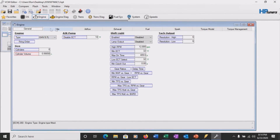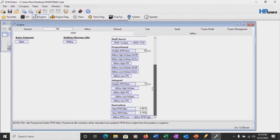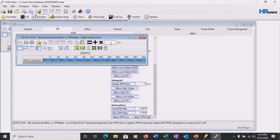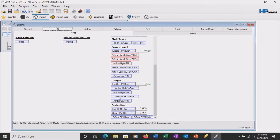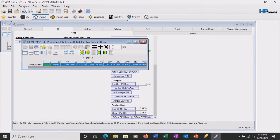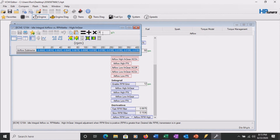We're going over to the idle tab, clicking on the RPM tab under idle. We can see the adaptive idle numbers and we go down to find anything referencing grams per second - the proportional, integral, and derivative, all in grams per second. We open the airflow high and low and multiply all by 0.8. For the sake of time, I'll fast-forward through and you can see at the end which ones need changing. Keep in mind idle may still not respond well to this.